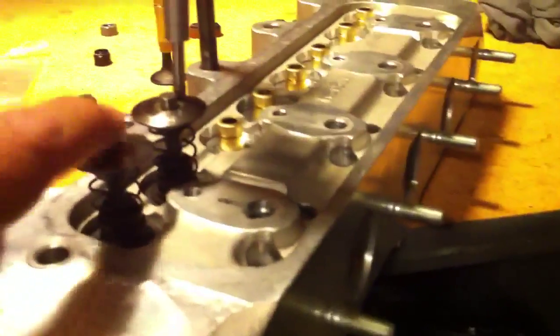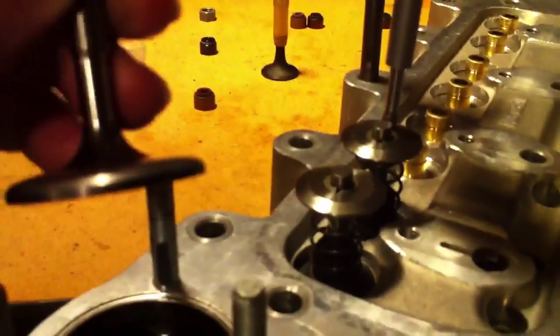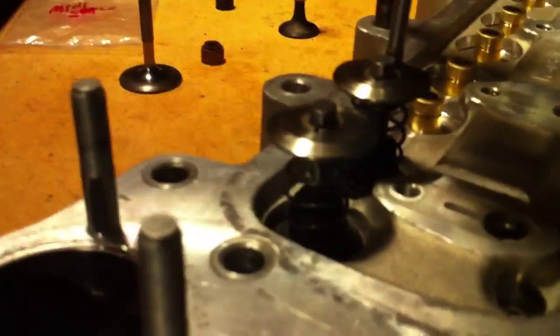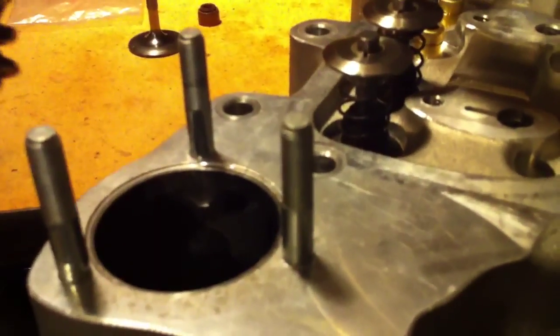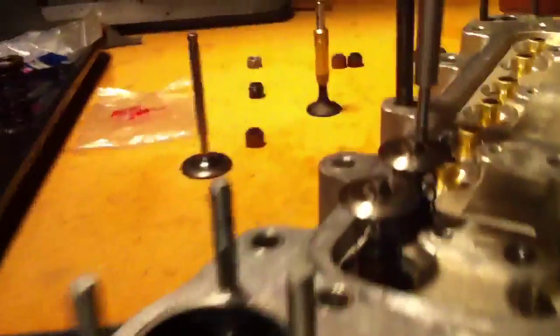So that's where I am — I don't yet have a solution. I may have to have these valves machined to lower them: make them go further up into the combustion chamber, hence making them longer up here, gaining a bit of room for lift and maybe even allowing us to dial in the spring pressures. Speaking of spring pressures, what we ended up with was the 526 springs, the anti-coil-bind type. These are the Mini Spares C-AEA 526 and 527 — these have too much seat pressure, about 140 at the seat, which is overkill. We don't want to put that kind of weight on a new cam. So we're going to run the lighter springs until the engine is broken in — maybe a few track sessions or races — then switch to the heavier springs once the cam is nicely broken in.